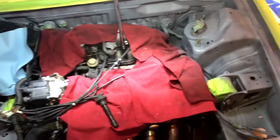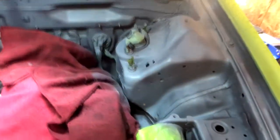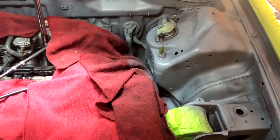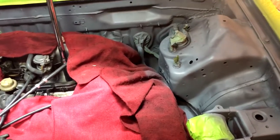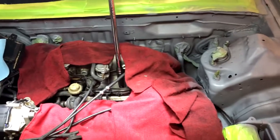Okay, so I've allowed it to dry for about 10 minutes. This is just two coats of really light primer. This is basically just for the paint to grab onto something, because if you don't put any primer, the paint is just gonna cake up on top of each other. It'll be really gooey and you're gonna have giant chunks. Like imagine the worst case scenario of orange peel, and it's gonna look horrible. It's gonna look like craters. So here we go.